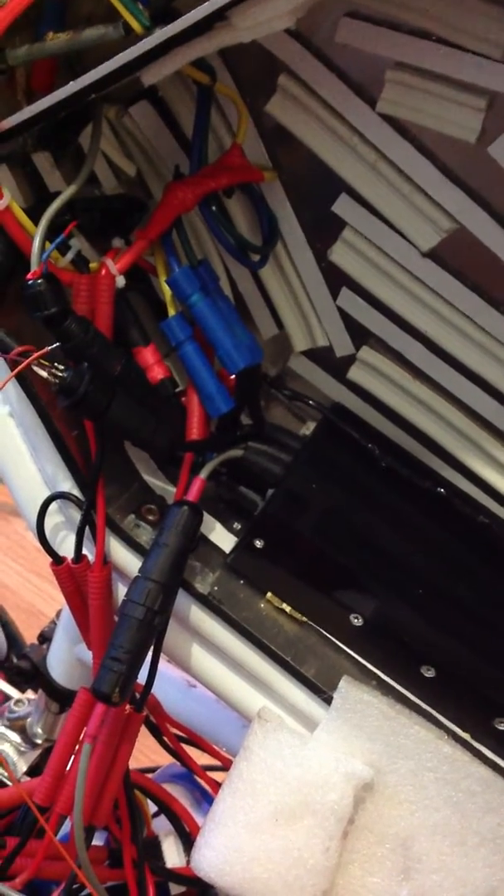If I can't work it out I'll have to send it back and get them to fix it, but fingers crossed. For now, once I've taped and heat shrunk this up and taped the wire linked here to the wire going to the screen, that can be my fix — it does work as a workaround. So if anyone has the same problem they can use this feed, but make sure it is the feed coming out the back of the display from the USB port because it's 5 volts. The feed going to the display, as I found when I tested it, is 12 volts — you don't want to link into that because you'll blow your sensors. It works fine with the 5 volt output from the display.